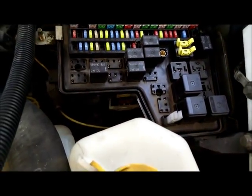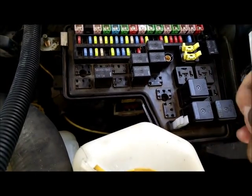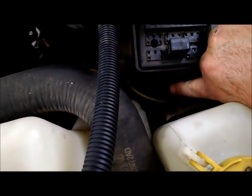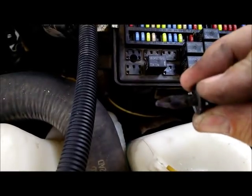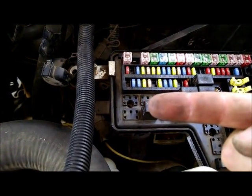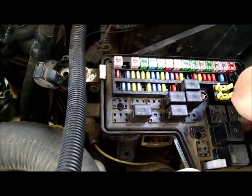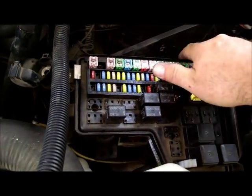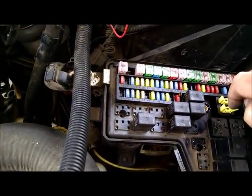The next step is on the side here — there's a bolt you need to take out; a half-inch will fit it. You're also going to have down in here a Phillips head screw — it's plastic. Once the screw is out, the plastic keeper piece will pull out of the hole. When you've pulled that out it's going to allow the entire fuse block to slide over. It's connected in the back by a couple pieces of plastic that clip in, so as you push it, it will slide over and become unclipped.